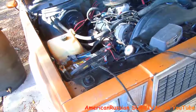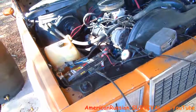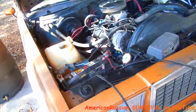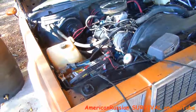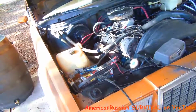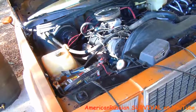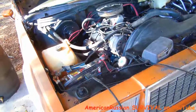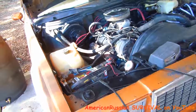It could be through even your starter motor, for crying out loud. A little bit of grease on your starter motor from a positive terminal that is making a slight connection to a ground. I mean, it's not really necessarily shorting anything out, but it's ever so slight that it's creating a parasitic draw. It's almost like a very, very tiny short. Even that alone could cause your battery to run down after 5-6 months if it's connected.